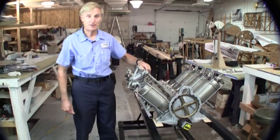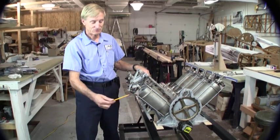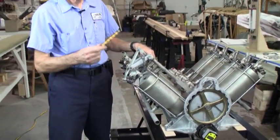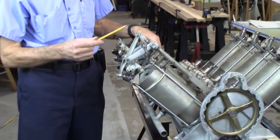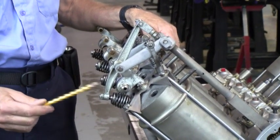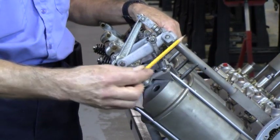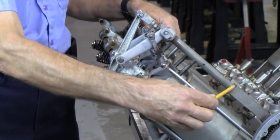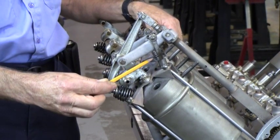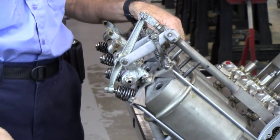As I said earlier, people often affectionately refer to the OX5 valve gear as a bunch of mouse traps. Well, look at it — it makes a good mouse trap, I can assure you. The best way to show you this is for me to turn the engine over. You'll see the rocker arm here operating the exhaust valve. You'll see this tube being controlled by this large spring which is being pulled down by this spring, opening the exhaust valve that I'm pointing to. We'll then show you another shot so you can see the main inlet valve spring operating as well.